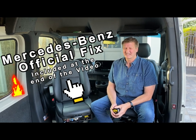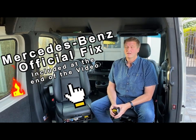We ended up doing a short-term solution when we bought the van, which was simply to disconnect that speaker and use the other speakers in the cab to listen to music. We did some research and found that several folks were using a passive component between the stereo and the front speaker — it's called an attenuator. It's an inexpensive component, like 20 bucks off of Amazon.